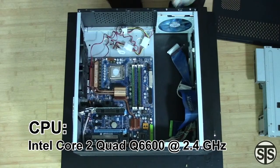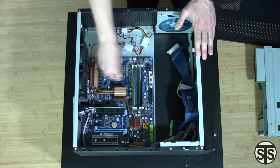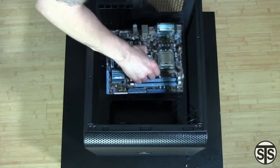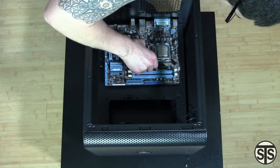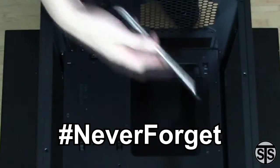I'll be upgrading the fan to the Cooler Master T4 as well — the unboxing is on my channel and a link is in the description. I cleaned off the processor with rubbing alcohol. I sized up the new motherboard for the case to make sure it sits right. After confirmation, I installed the IO port plate. Hashtag never forget.